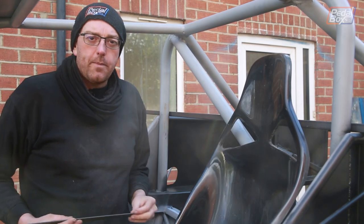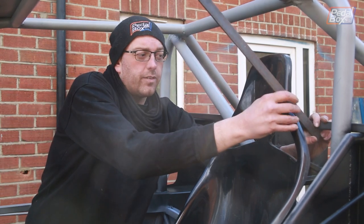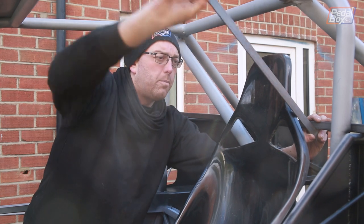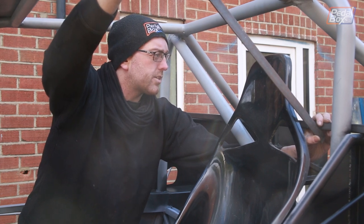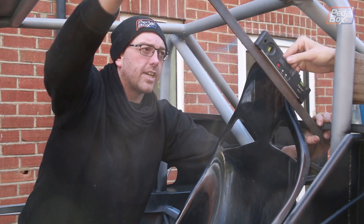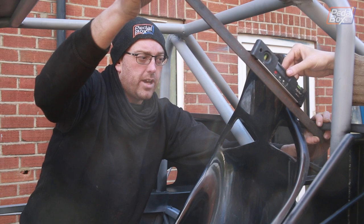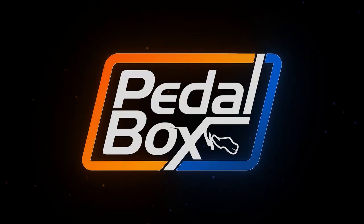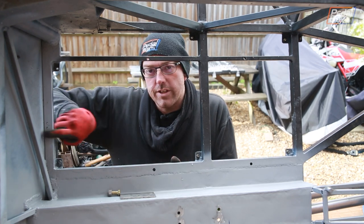With the seat pushed all the way back we line this up again, with the bottom edge of the bar going up to and over the shoulder we measured before. Holding it roughly in position, Chris measures the angle against the chassis to get a baseline. That comes in at 39 degrees — still a little high. Chances are it'll probably sit a little bit lower because I'll be a bit further forward in the seat, which brings it to about 32 degrees. With a bit of measurement we've worked out a 65-degree angle for the seat belt for me, which puts the mounting point about 14 inches in front of our firewall.